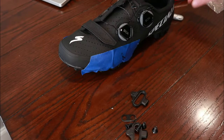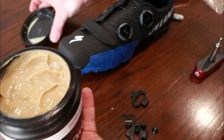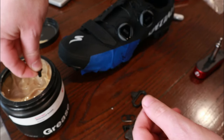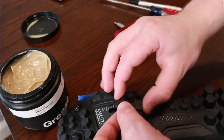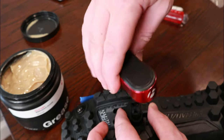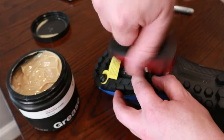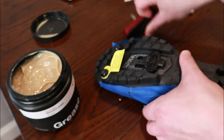Open up a little bit of grease because we want to make sure these cleats don't get totally seized. Use just a tiny amount. From here, screw the cleat in snug but not all the way, because we still need to figure out rotation after this — so just get it slightly in there.